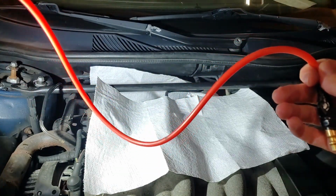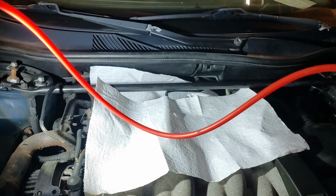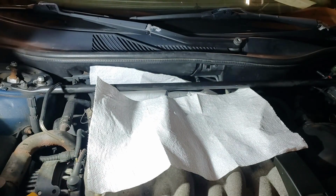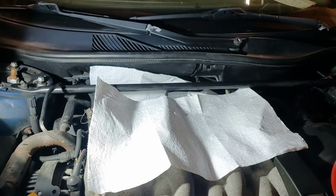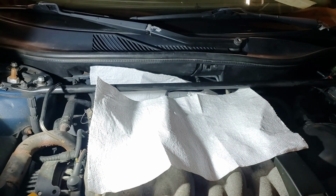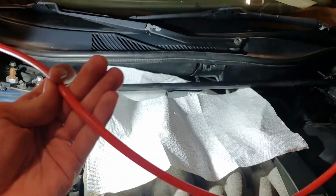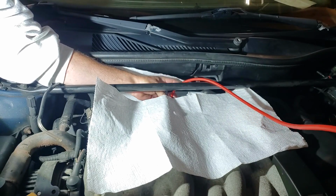Now this is why it's so important earlier on when I mentioned you want your piston at bottom dead center, and that's bottom dead center of the piston you're working on, and having those valves fully closed, because when we start blowing these chips around, you don't want them getting up into the intake or exhaust valves and causing you lots and lots of issues. So with everything closed up, this should give us the ability to blow some air down there and have them actually fly up and out of the spark plug hole. Now you want to make sure you're using eye protection here.